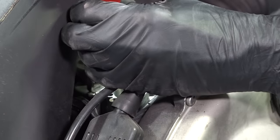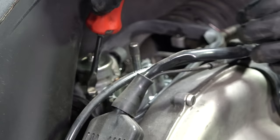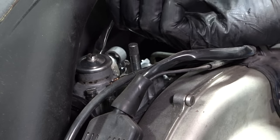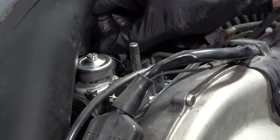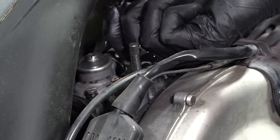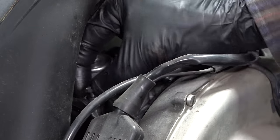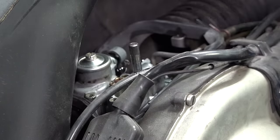It's flowing really good on reserve — I don't think there's any problem with fuel flow. That's also a good idea just to clear out the lines of any old fuel. Next thing, since this is off, we're going to pull this carburetor top — this is the float top, which houses both the fuel filter and the float. It's an awkward angle, but it is possible to get a flat-blade screwdriver or even an 8mm wrench on these. This is a Spaco replacement carburetor, so it's probably been replaced in the last 20 years.